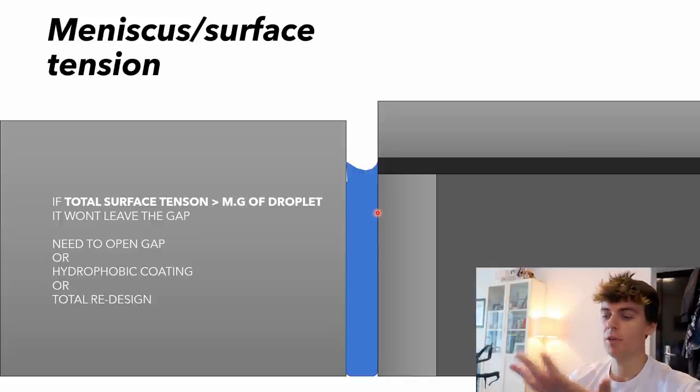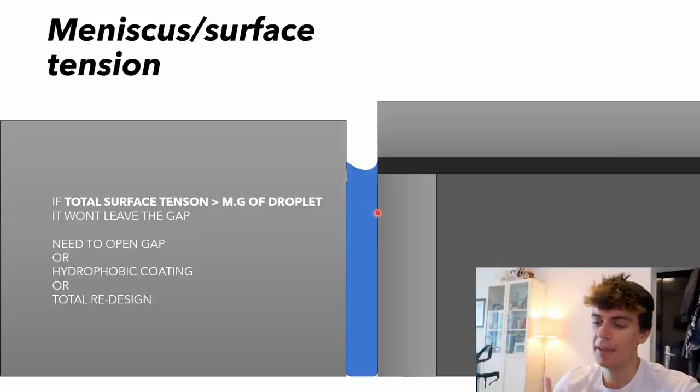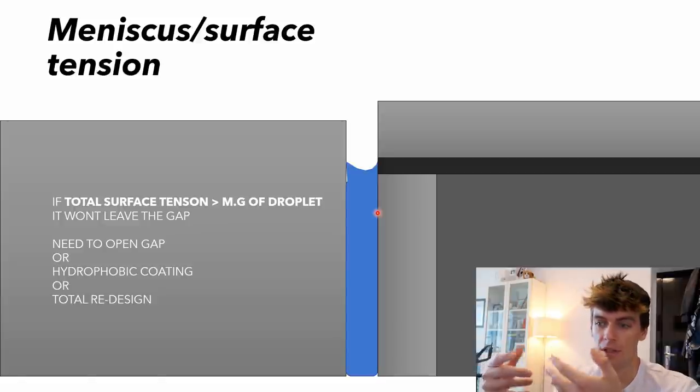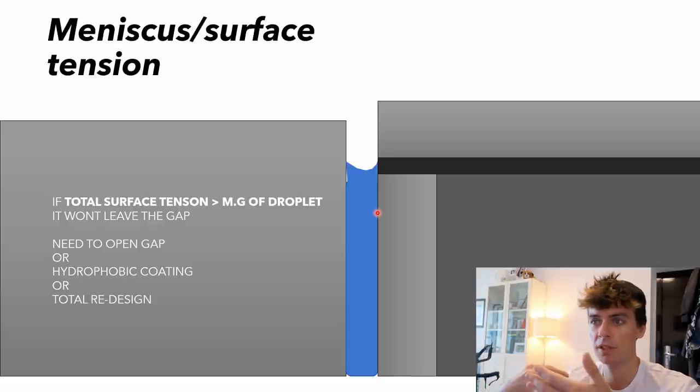Now, in aerospace structures, in airframes, there are regulations and guides about joint gaps. So if you've got a bonded and riveted or a bonded and bolted joint that can get wet or get condensation on it, there are certain rules you follow about how far that is from another component, because if you get water settling in that gap which can't be blown out or can't dry out, then it's a site for corrosion. It's like an old car.